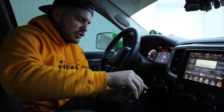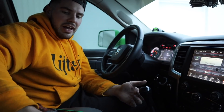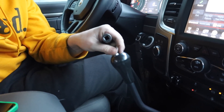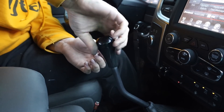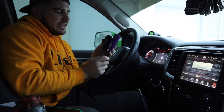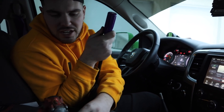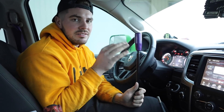Don't think you've got to drill the knob out. If you shove it back in here correctly, this is where you can orient it vertically, upside down, whatever. And then in here there's a 15-millimeter nut — the knob itself literally twists off. There's a washer and a spacer in there. Now if you want aftermarket knobs, this is a 10 by 1.5 thread — literally a 10 by 1.5 thread pitch.